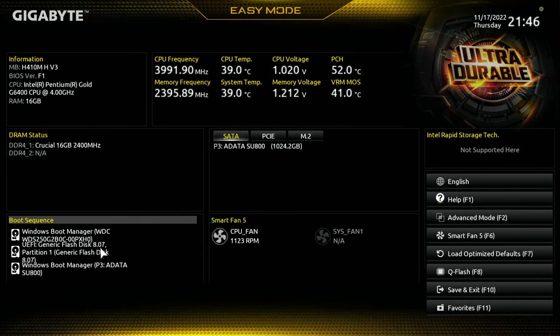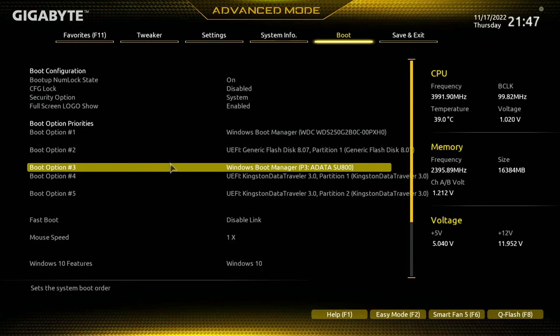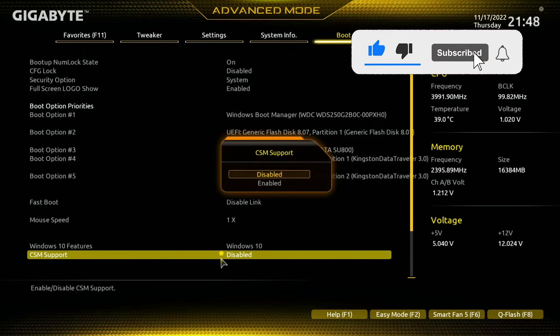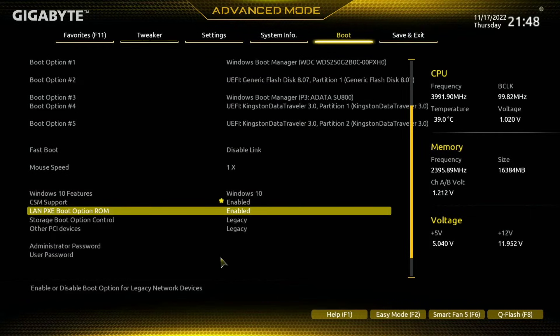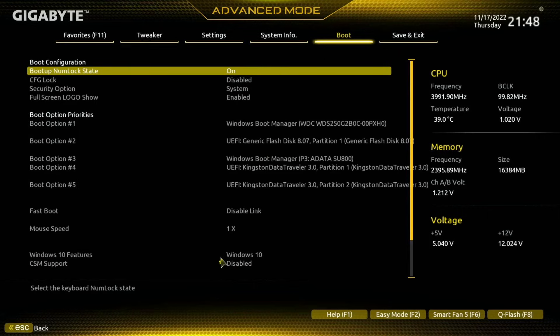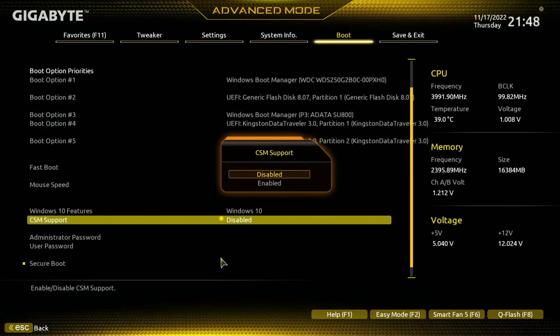If your drive was not visible in the boot sequence in easy mode, or in the boot menu in advanced mode, it's probably because you need to enable CSM support. CSM support enables more options for drives, but it doesn't allow things such as secure boot to work — ideally you want to install Windows using UEFI. To enable CSM on this motherboard, go into the Boot menu and come down to CSM Support, then click on it and click Enabled. Keep in mind, if you had secure boot enabled, you can see it in the Secure Boot menu — it must be disabled before you can enable CSM boot.